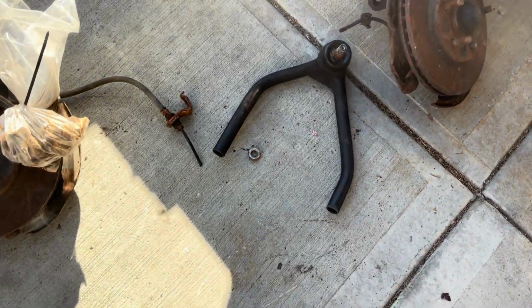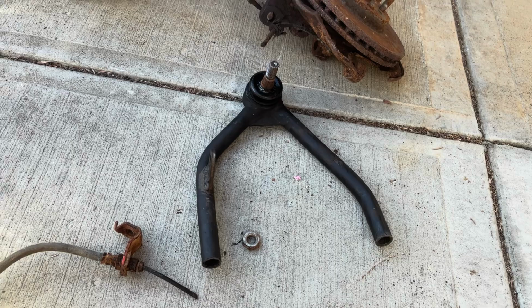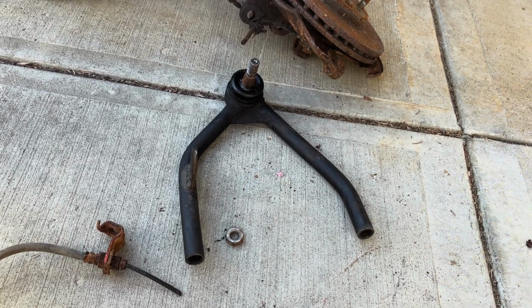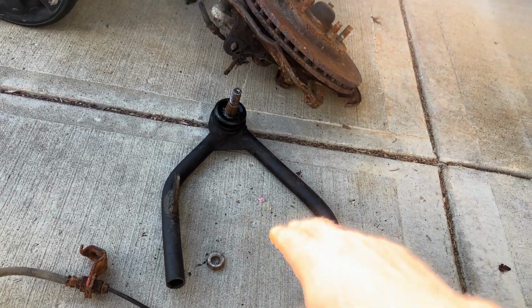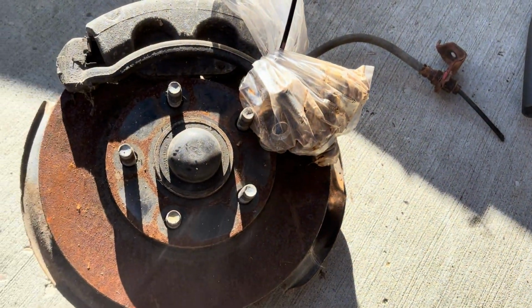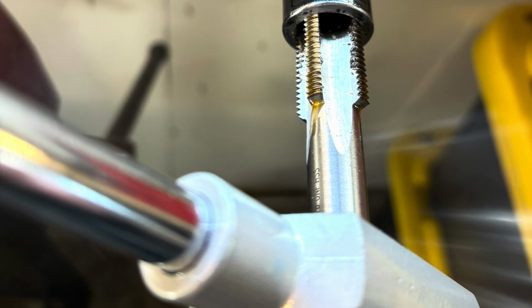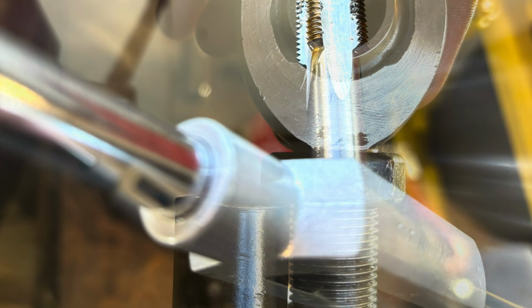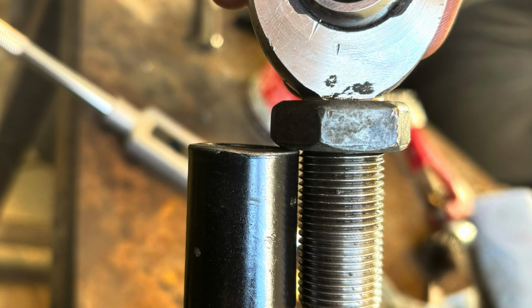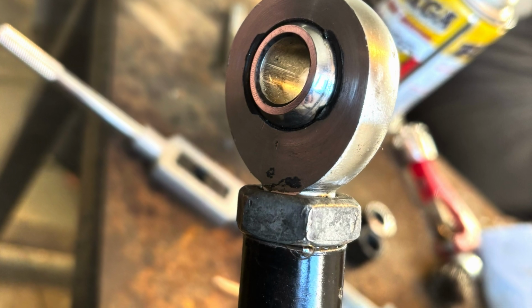But the wheels I'm currently running now don't have that super positive offset like that junkyard Space Saver aluminum wheel I had. So anyway, if we move this in an inch, that's going to make up for the offset on the wheels. Here I just took a tubing cutter. That ended up working really well. I wanted a super square cut. Then I tapped it, then threaded everything in, got everything all cleaned up, and put her back in. Things seem to be pretty good.